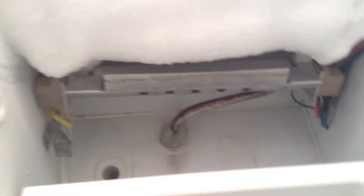The problem is this heater right here — it's bad. There's a temperature control, and we have new parts that will go there. Hopefully this will fix the problem of the refrigerator not freezing. Look at all this — it's like a glacier. Because at the back of that are coils, and it cannot pump cold air because of all this ice blocking it. So we gotta defrost this one first before putting in the new parts.